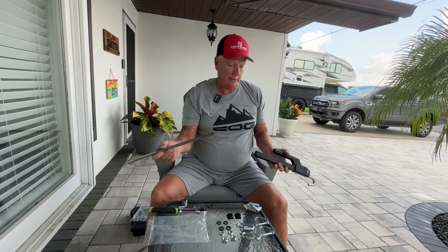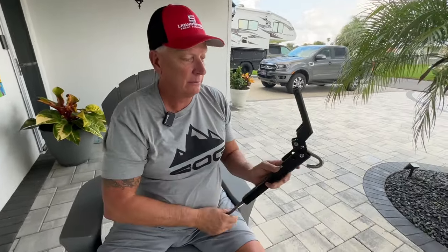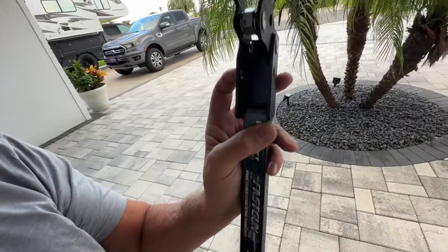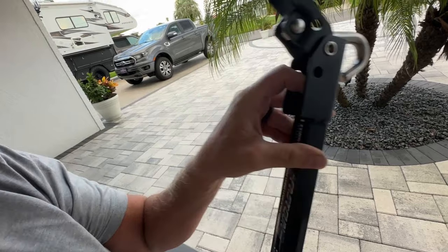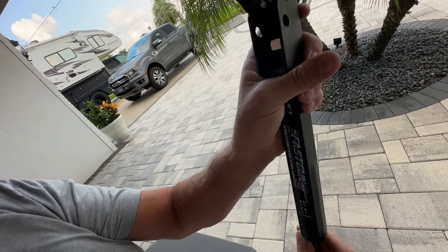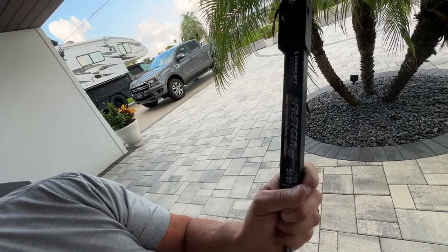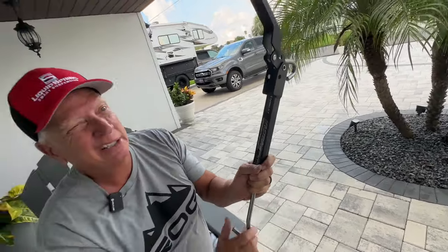The assembly is not that hard. You're going to grab your Fast Gun, grab the rod, and put the rod into the assembly. Lift the handle up until you see the rod coming out. Once you get to that level, you're going to take a flat nut and stick it on here. Bring it in just a little bit and twist, and you'll see that it'll start to catch. Once it's caught, you're just going to twist it, because the flat nut won't turn since it's the same size as the diameter. You want about maybe an inch and a half thread on top of the flat nut so you can do the rest.